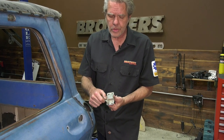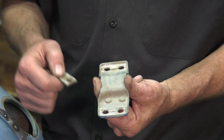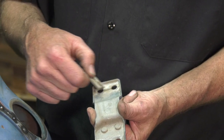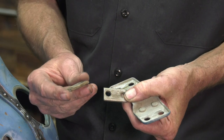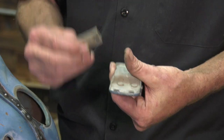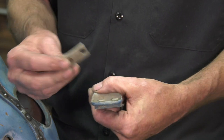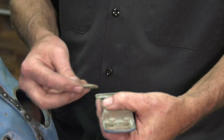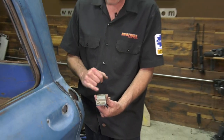There's a horizontal serration right here — a little raised edge — and it's the same on the top and the bottom. These spacers help hold the striker in the right spot. You'll notice the horizontal serrations match up with the spacers, and then the vertical surfaces go against the cab, so you know this orientation is correct.